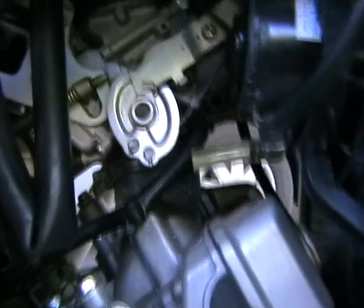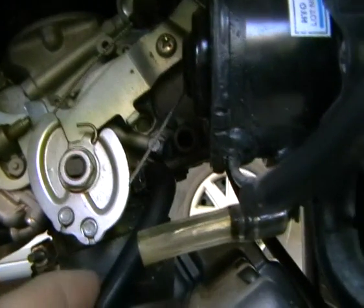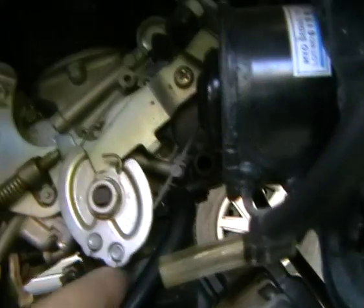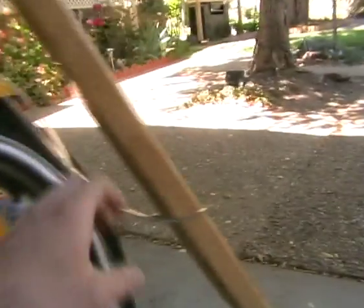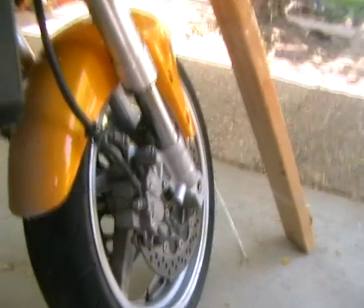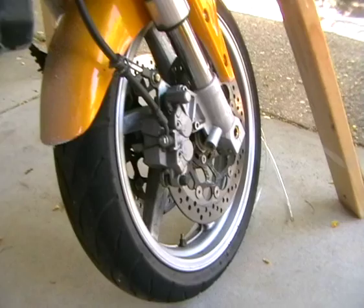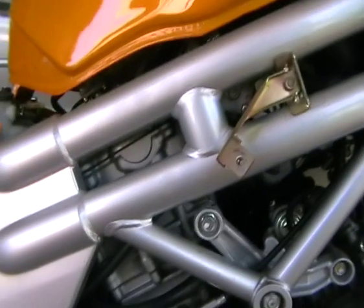What I did first is tune up the bike. Up underneath here there's a tube that exposes the nipple on the front of the carburetor. You need to take that tube off and put your manometer tube onto it. Underneath the tank you can see another one on the carburetor — take that one off and plug both of those manometer tubes onto those ports. The tank won't be pushing fuel, so you'll have fuel in the carb bowls — that'll be enough to tune it.